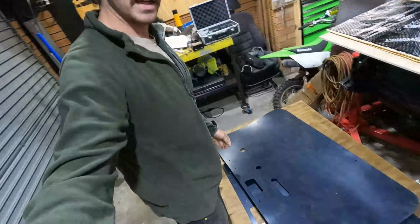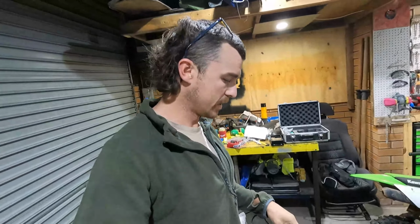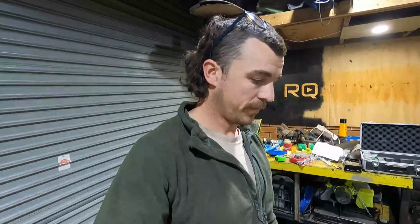It's the next morning and these guys are good to go. I did run around them real quick with a little deburrer tool, like the same one that plumbers use to take the burr off a piece of pipe. So they're all nicely cleaned up on the edge. The reason I did that is because otherwise the edge is very, very sharp, so it would give you paper cuts every time you touched it pretty much. It'll also stop it getting little chips on the very edge that'll be real noticeable. So if I put a chamfer on there, it's not gonna do that.